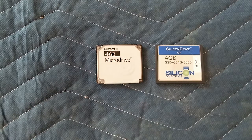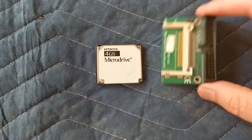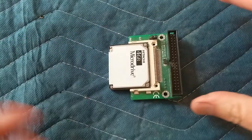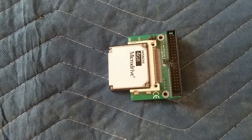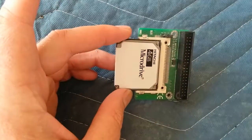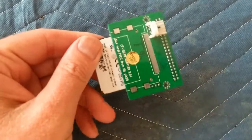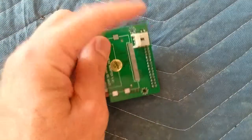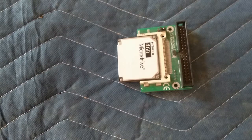I used this in a little mini PC build. I used a compact flash to IDE adapter — this was before SATA came out — just jammed it right in. I put Windows XP on there and it booted up fine, ran fine. Boot up was a little slower than a normal hard drive. I think this has about a 12 millisecond read time and spins at 3600 RPM, so a little slower than a 5400 RPM drive, but it did the trick. It needed external power plugged into the power supply to work.